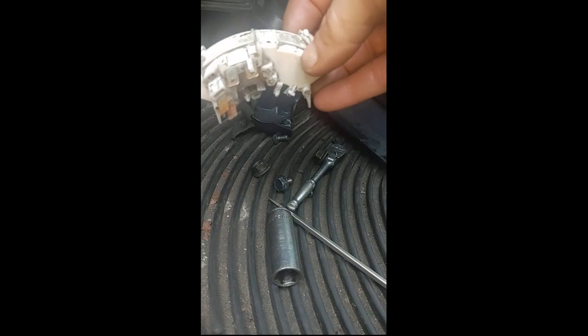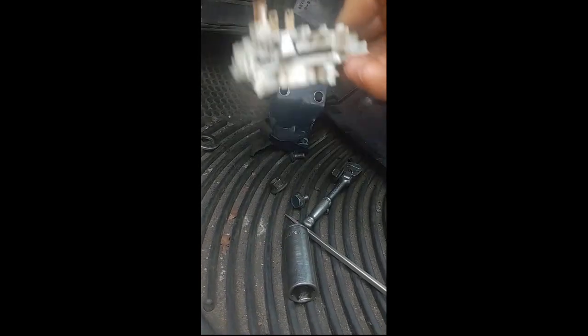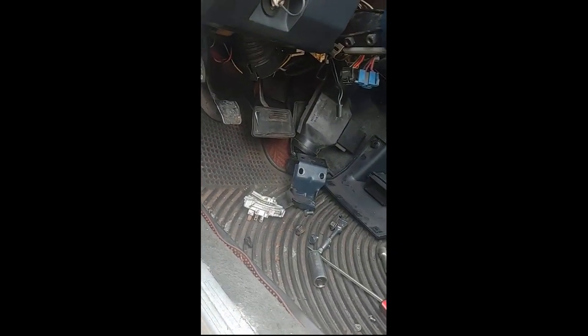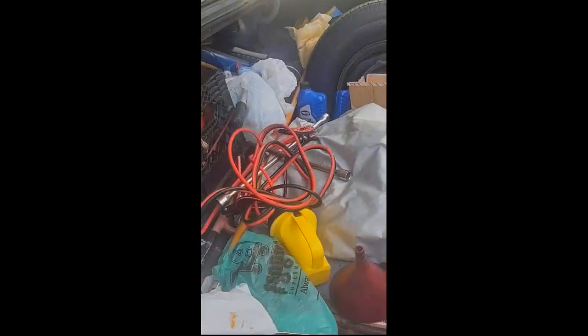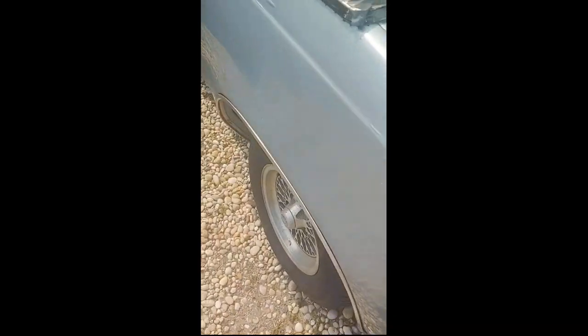I'm following this red wire and it was directly cut off the reverse lights. I'm not sure if it's something where guys used to put a stupid switch in for the reverse lights — it was a trend about 20 years ago. The original switch was bad — couldn't get it to work. But it's going to work now because I'm going to hook that wire back up and forget about the red wire. Somebody also crimped these connections very poorly — I pulled on them and they just came right out.